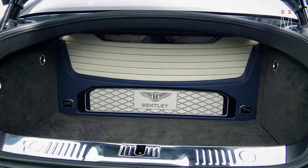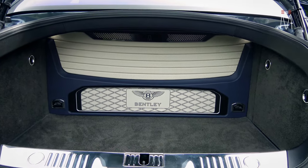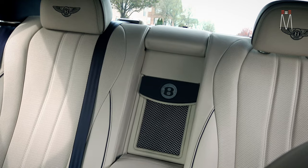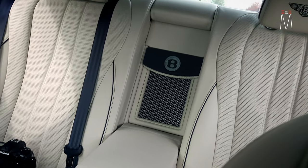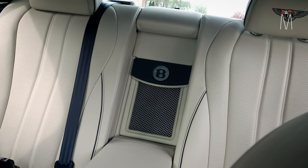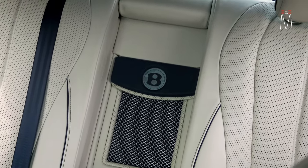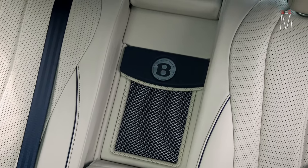This trunk setup uses a lot of the materials found inside the car, bringing that design element and DNA to the trunk. The pass-through for the subwoofer goes through the ski hole — that's a decorative trim that still allows air to pass while looking completely finished. This piece can fully fold back up, however it will decrease airflow and increase the chance of resonance in the trunk. Everything was made using factory combination of materials — the same grill cloth used in the trunk — and we utilized the blue and perforated materials.